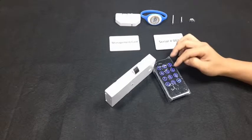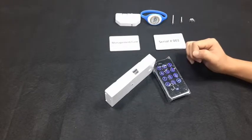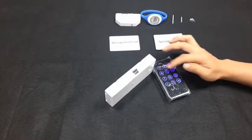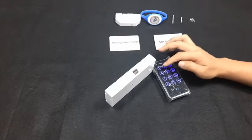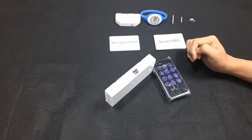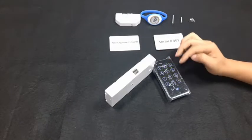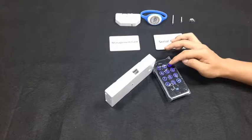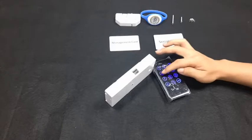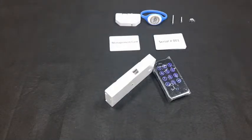To add user codes: touch the panel — it beeps. Input the management code 6, 5, 4, 3, 2, 1, press the key icon, then press 8. It beeps and the blue light blinks slowly. Input a code serial number — for example, 001 — then press the key icon. It beeps and the blue light blinks quickly. Input the user code, press the key icon — it beeps. Blue light blinks quickly. Input the same user code again, press the key icon — two beeps. You can continue to add new code serial numbers and new user codes. After five seconds the latch gets out.